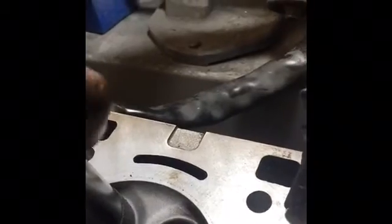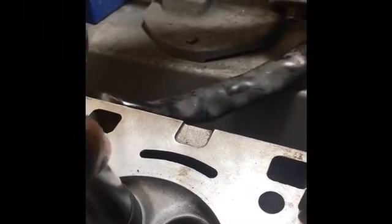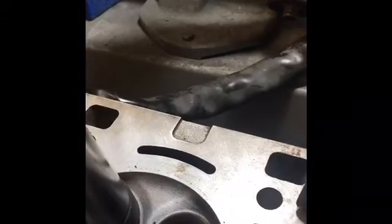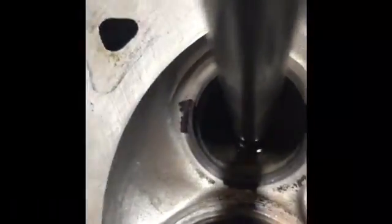Okay, we just cut our 60-degree, we got the sharpied surfaces. We'll grab our 45-degree grinding stone, place it on top of our centering shaft, and work it around a couple times. Mind you, we're not pushing hard, just rotating it on the surface. We shouldn't need to push hard because the surface is uniform. Okay, so we're actually looking pretty good. Thickness looks good. I'll measure it here in just a second.